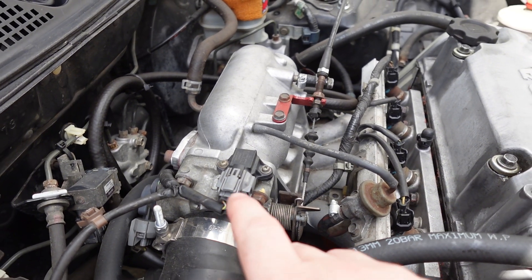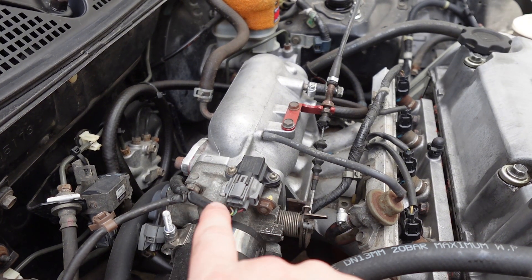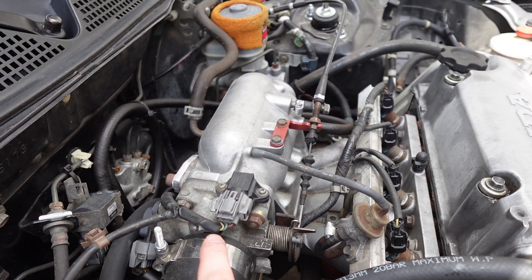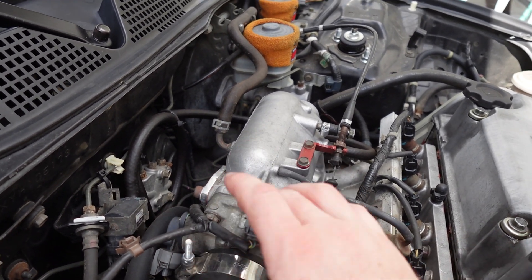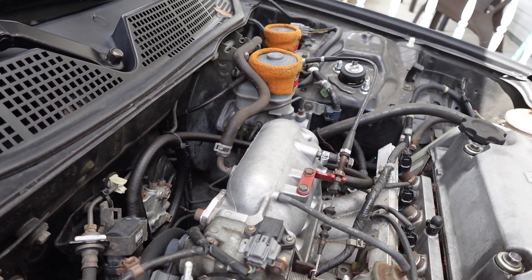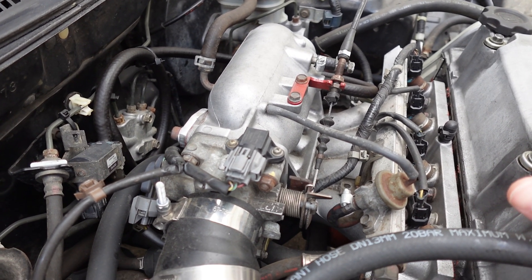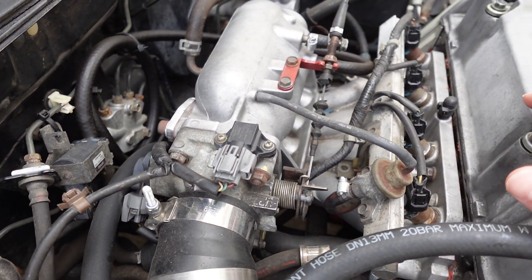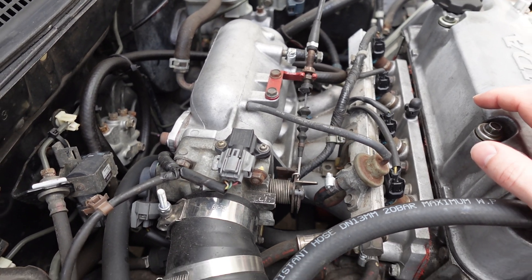You're not talking about a major amount of gains there, but little things add up — better flowing. Some people are also going to be running a larger throttle body like a 70 millimeter, so you're going to need to port that intake to 70 millimeters. If so, you'll want to buy some Dykem layout fluid, paint the surface of the intake, scribe the area you need, and then mill it out with a die grinder. Just don't take too much material.